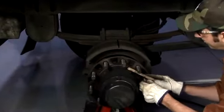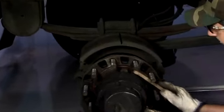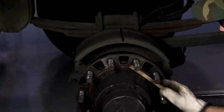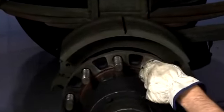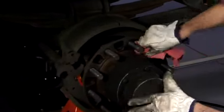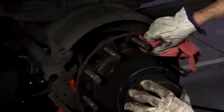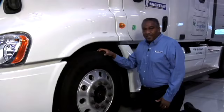The best practice is to use a wire brush to clean all of the mating surfaces and remove any traces of foreign material. Failure to adequately remove all of the debris will permit the corrosion to continue. All abrasive residues should be removed with a clean shop towel. Do not use acid or other highly corrosive material to clean the hub or mating surfaces. These materials promote further corrosion if they are not completely removed.